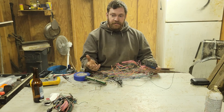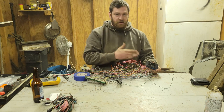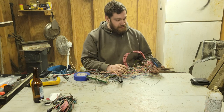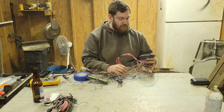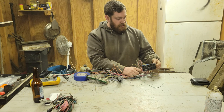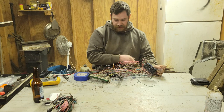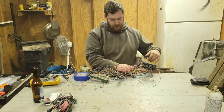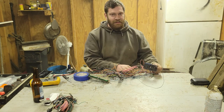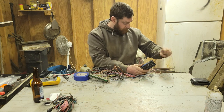But to be fair, all of your fuel injectors are on one fuse anyway, and your ECM, all of that is on one fuse anyway. I didn't really think about it until it was explained to me, but yeah, that kind of makes sense. I have a couple of wires here that I'm going to track down once I get this cut. Oh, there's one I don't need. And I'll see where they go and then fuse them accordingly. But that's it, guys. I swear. Is this a...